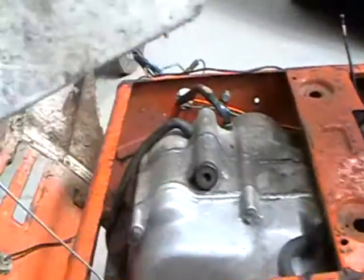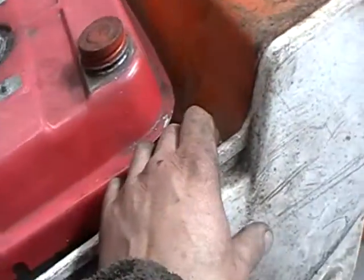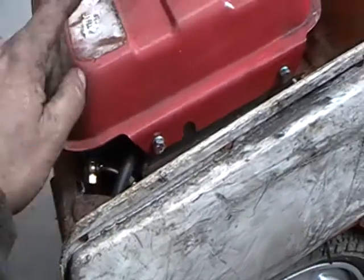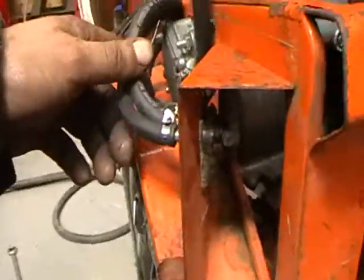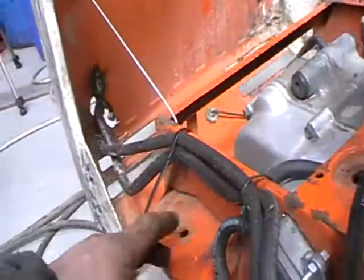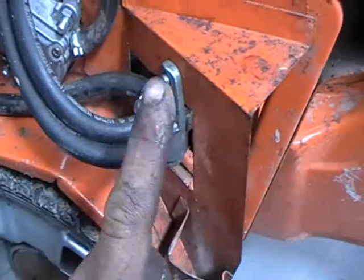Fuel is taken from a rear-mounted fuel tank because the carburetor is where the new one is. There's a feed out there and one in the centre of the tank that is higher up. This gives reserve fuel capacity and is switched via a two-way switch located in there. Fuel is drawn through the tap through either the reserve or the on position.